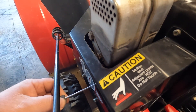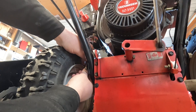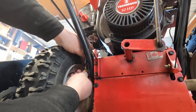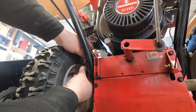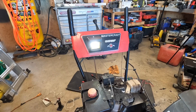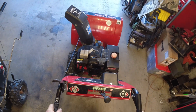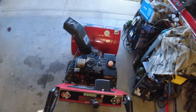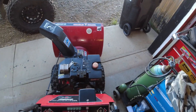Right now I'm just doing some carburetor adjustment. This is the idle screw, but you need to adjust the main one first before you go to the idle — I do these a bit out of sequence but you get the idea. And here we are, running without the choke on, which is super nice! If you guys enjoyed the video, post any questions or comments below. You can either fix your old carburetor or just replace it with a new one — whatever you find easier. Take care.